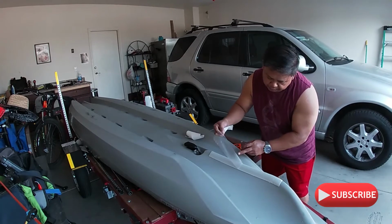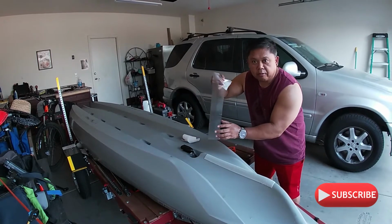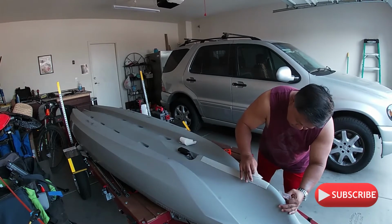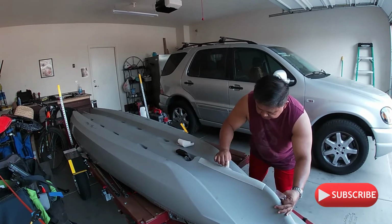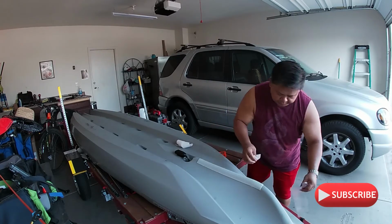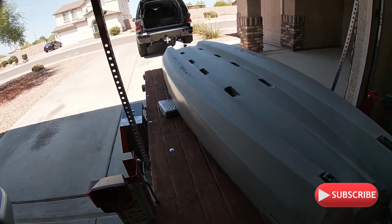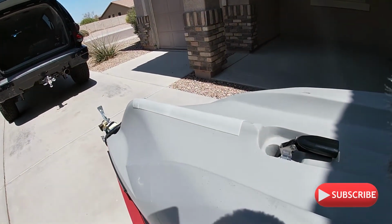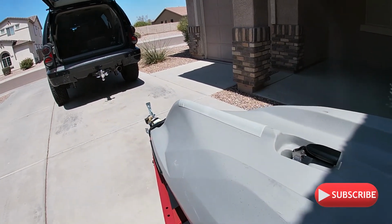And under the sun, it'll cure within about 5 to 10 minutes, and it'll harden up. There you go, that's the backing. So you want to still try and mold or get those bubbles out when you're working it. Make sure it lays flat. There it is. And we just let it cure. To cure the Gator Patch, you have to give it some sunlight. Good for about maybe 10-20 minutes or so, it'll cure up and harden. And after that's done, it's good to go.